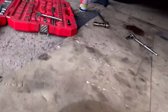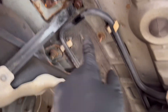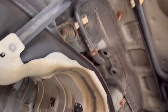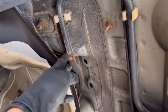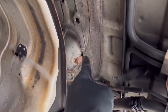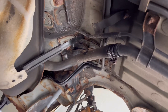I'm going to show you guys — you might have to put some PB Blaster on there as well, but it's pretty easy to take this off. There's a bolt there and a bolt there as well — they're both 18 millimeter bolts. And then there are also a couple of connections right here for the fuel line you'll take off, and also right here — this one is 11 millimeter.